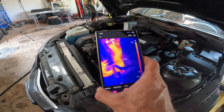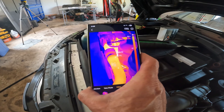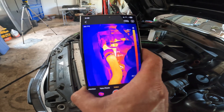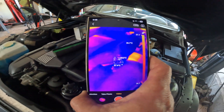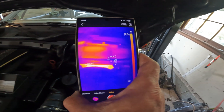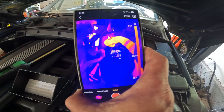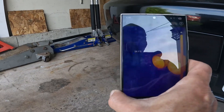You can also use this for cooling systems — check for blockages and see the output temperature of your upper radiator hose. That's my thermostat right there, and it gives a really good quality image. I can check another heater pipe going to my expansion tank to see if I have good flow and look for any issues with the hoses. You could also use this for exhaust leaks as well.